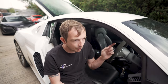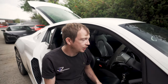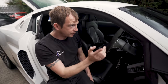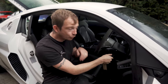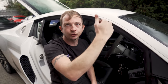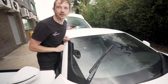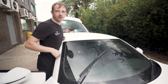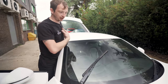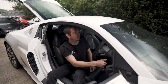If you take the front trunk panel off, and you take the wiper arms off to get the scuttle trim off, always remember, before you put the wiper arms back on, turn the ignition on, press the wipers once so they re-park, and turn the ignition off. Now you can put the arms on because the motor's parked. We get so many people come in where the wiper has damaged the windscreen or the scuttle, because they've taken the wiper off and now the motor's in the wrong position, because it knows where park is. So you put the arm back on, sweep the wipers, and it wipes out your bonnet or your A-pillar. So just be careful with that. It just reset, it knows.